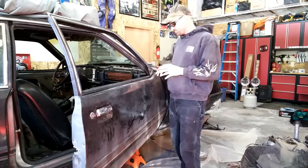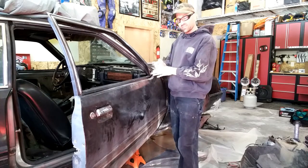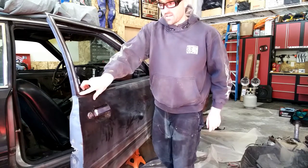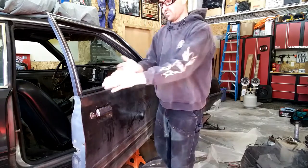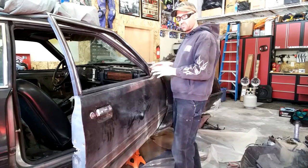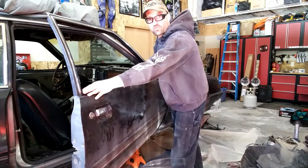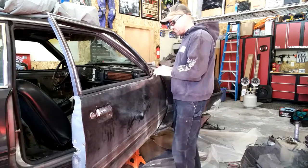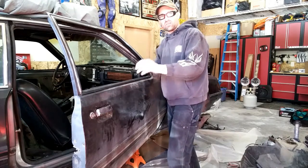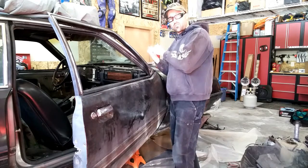Once you have your screw back in, make sure everything lines up. This tab has a little indention behind the mirror — it should fit in there, not be on the radius. It should be far enough forward where everything fits nice and flush. All the way down, make sure it's snapped in. You can do a little bit of adjustment since it's got a slight slot — you can move it back and forth, even trim the ear a little bit to get it to fit. I prefer it to fit better on the back where it's visible than up front under the mirror where it's covered. Once this is done, go over to the driver's side.